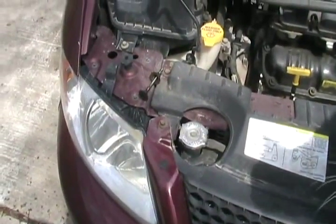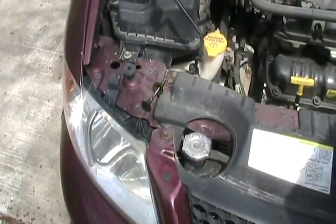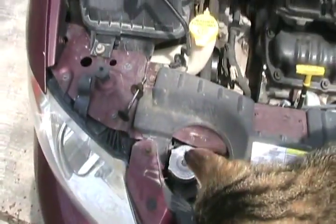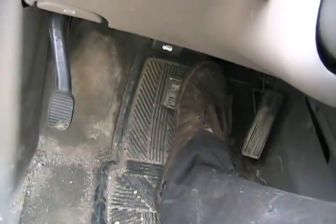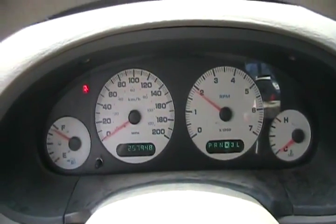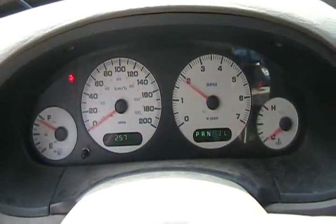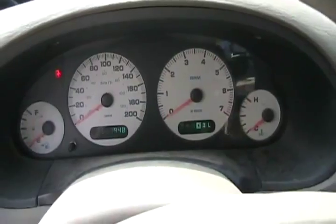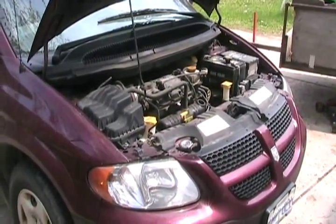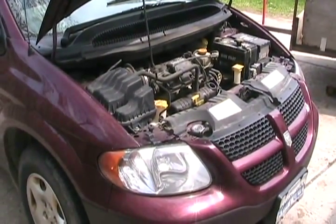The best way to test for a bad head gasket is when the motor's cold, like overnight. Release your rad cap, take it completely off, then put it back on. Then start your engine up, put it in drive, put the brake on hard, and accelerate to 2,000 RPM with the brake on hard in drive for 30 seconds with a totally cold motor. Then shut her down. A good engine when it's cold will have no pressure in there — so be careful, be aware. It could spray you and get that stuff in your eyes, although it won't blind you.